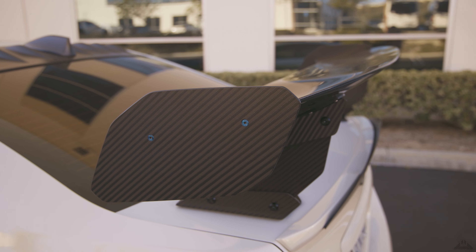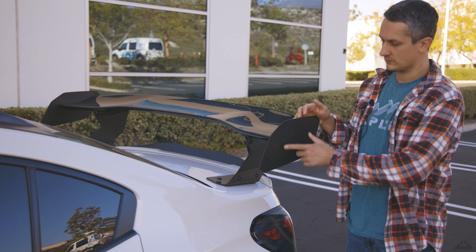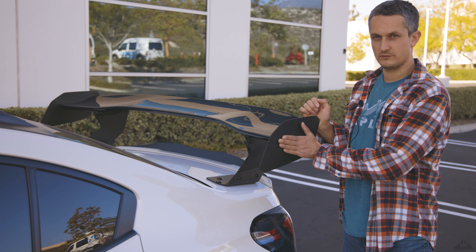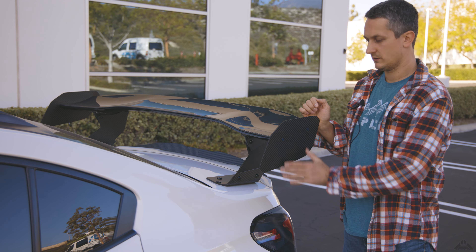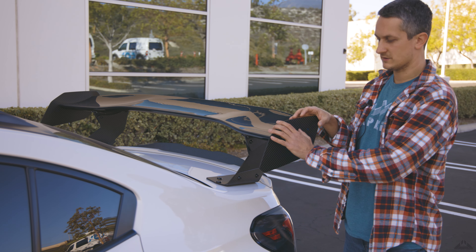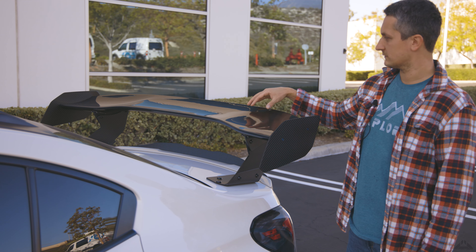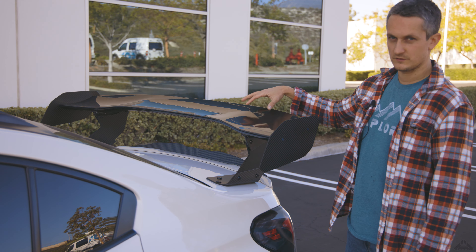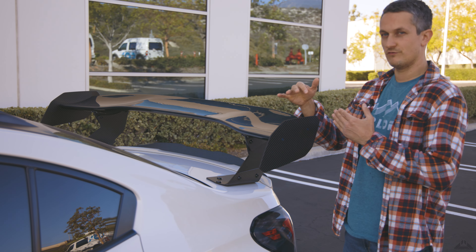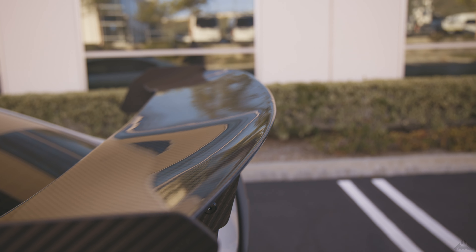I added slanted corners to the side plates. The bolts are titanium with blue finish but I plan on replacing them with black finish bolts that blend in better. I decided to go for a countersunk flush finish instead of using a washer. All the parts I make for my car are in satin finish - I prefer this matte satin look, it just looks more sporty. The reason I did not want to spray the main airfoil is because there's a lot of unevenness on the surface, and flat finish actually reveals all the defects really drastically.